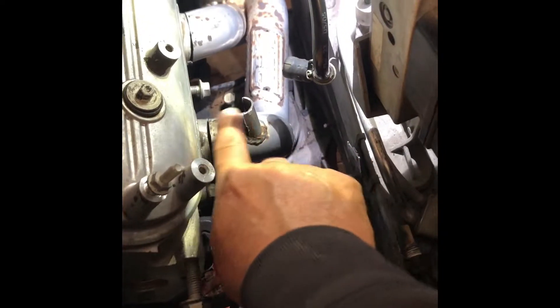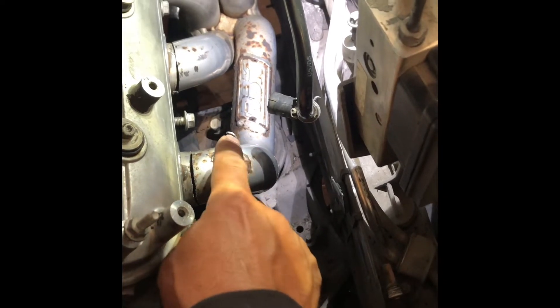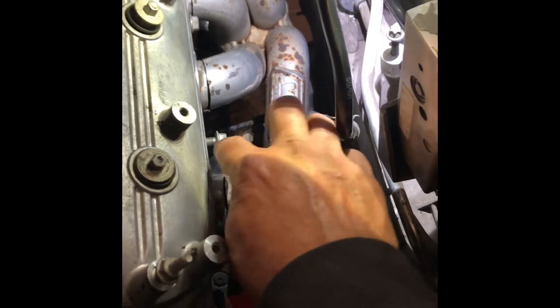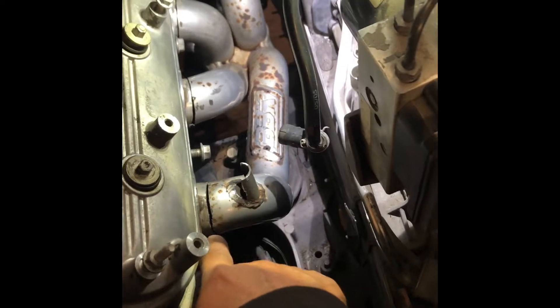I cut the little piece that was here, cut it in half, and I'm probably gonna cut it some more down here on the other edge, bend it down, then cut it to the shape where the weld's at, tack a weld on top of that and close it up. Then if we got enough clearance, I'm just gonna start tacking these — one spot, jump to the other one — and keep doing little spots to fill it all in. Let's go underneath and see what our clearances are.